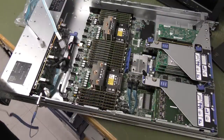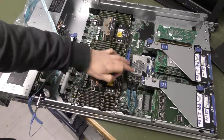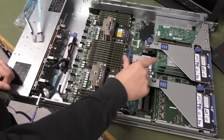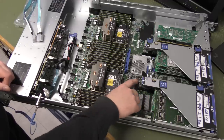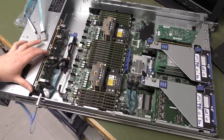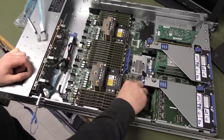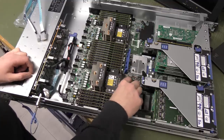To get this moving, we need to connect this drive bay up here. This is the RAID controller mounted on the system board — port one and port two. Right now that goes up to this first drive bay, but it's going to go over to the extender instead. We're going to take port two and port one out here.